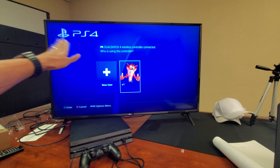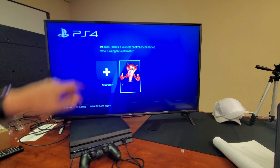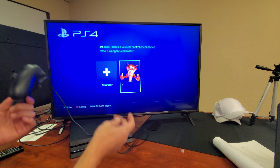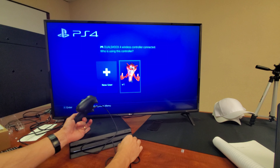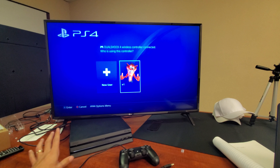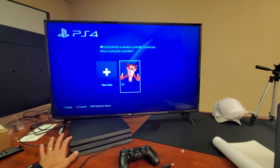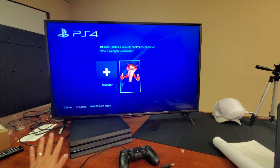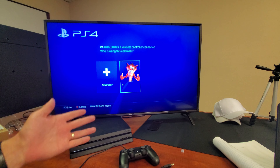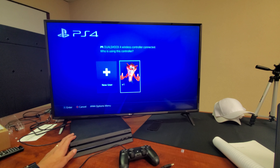With everything on, let's pretend I see no signal on the screen. First thing: go ahead and make sure your remote USB is unplugged from the PS4 itself. Now what I want you to do is press and hold the power button for seven to eight seconds. Wait till you hit a second beep, then go ahead and let go, and that should boot us into safe mode. Here's the power button right here — I'm going to press and hold.